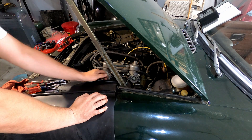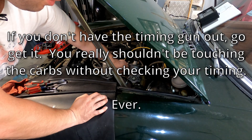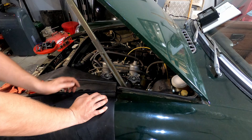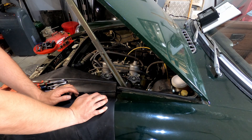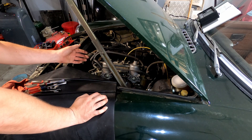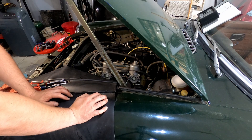While you've got the timing gun out, what I was showing you is that you can press on the throttle here. Every carburetor is going to have that. Just twist the throttle by hand and you want to watch that timing mark. If it's working properly, the timing mark should advance when you're raising the RPMs and it should retard again when you lower the RPMs back down.